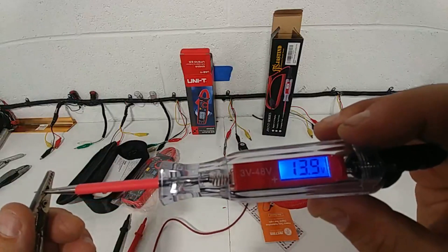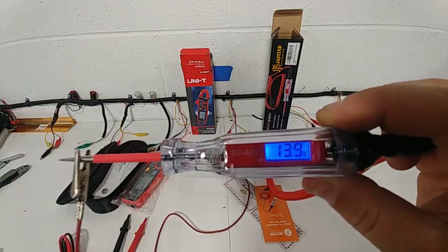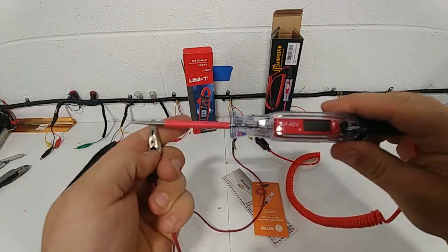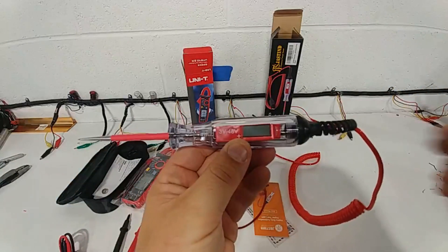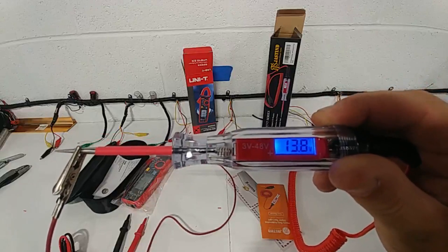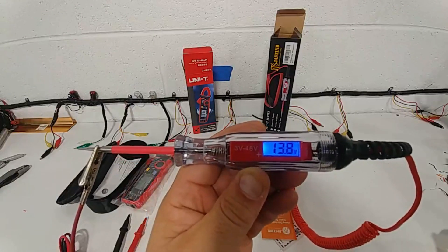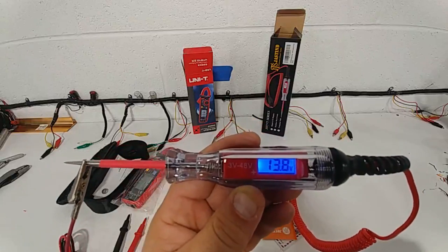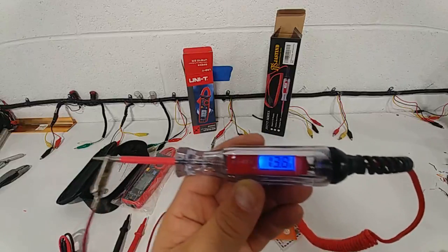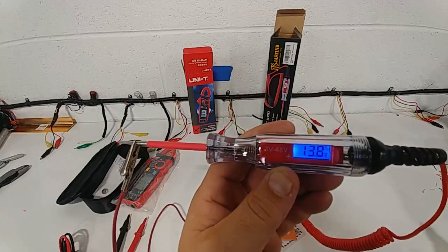You can see when it goes off — 14.1, got a little spike there when I turned it off. That's what you're gonna get, and I like this because it tells you positive voltage. If you end up hooking it up backwards and find a ground instead, it basically does nothing — it's only gonna pick up on your power and display the voltage, 13.8. This is especially useful for determining if you have full battery voltage — 12.8 or 12.6 — on your lights. Particularly for our auto flasher, you can look specifically at the voltage to find out if it's five volts, or if you're only getting nine volts, or whether your DRL lights in park are at full battery voltage or not.